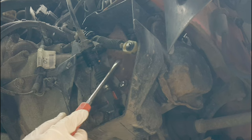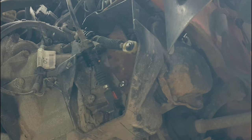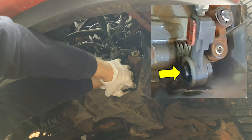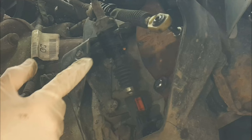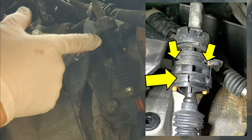Now disconnect the cables from the gear change arm. This is the gear change arm here — this large steel part that looks a little rusty on this car. A small pry bar will do to get that gear linkage off, and this lower one comes off by pressing this button and pulling it off the ball joint. Now we need to clear these cables out of the way. I've applied a little penetrating oil just around here and into each side where these attachments fit into the bracket on both of them.